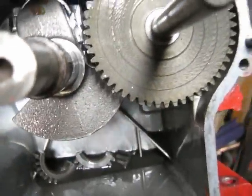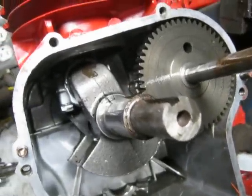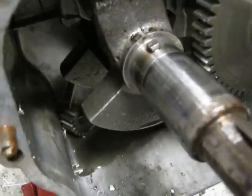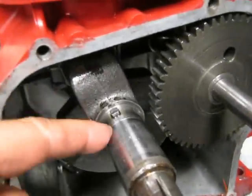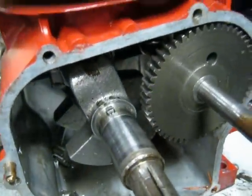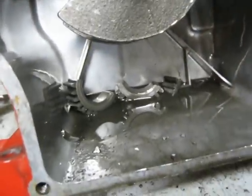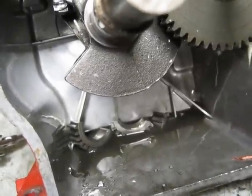You can see it had a talk with the connecting rod there. The camshaft doesn't want to turn very well — it's got some dings in it. It seems that these non-integral crankshaft gears don't like use in my Frankenbriggs engines. I broke one in pieces on the 327 there, and the three-cylinder radial stacker engine too. Whereas the old crankshafts with integral gear, I've never had any problem with them. I wasn't really expecting this. This particular engine was used on the four-cylinder as well as the six and now the eight, so it has seen a fair amount of use. But I certainly wasn't expecting it to break the crankshaft gear. It's probably vibration and harmonics, something like that.